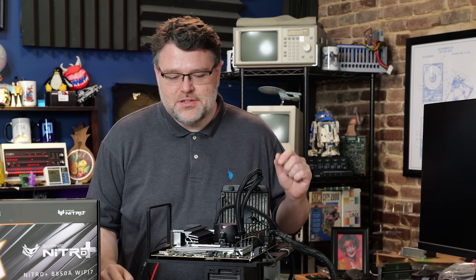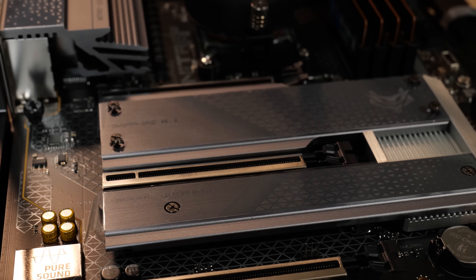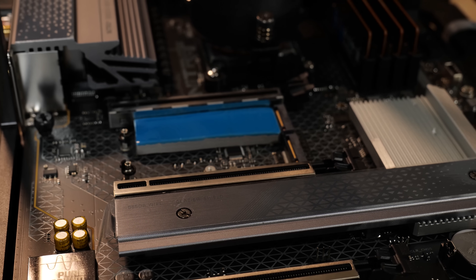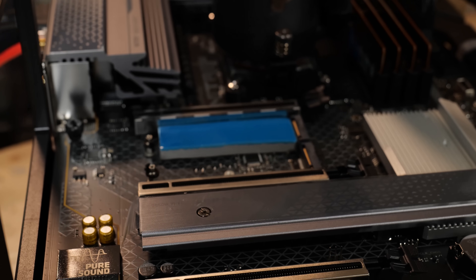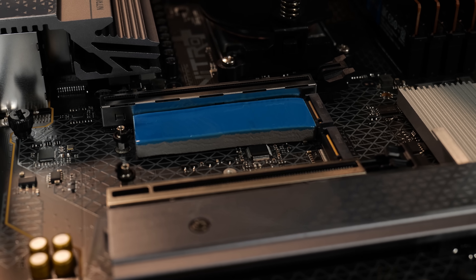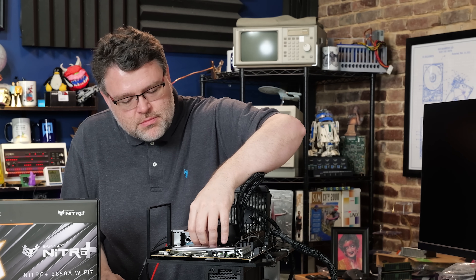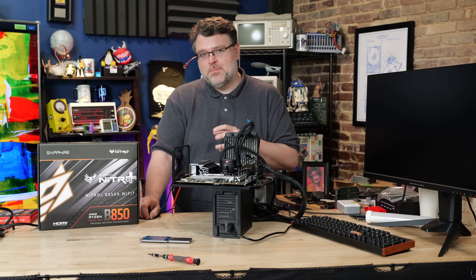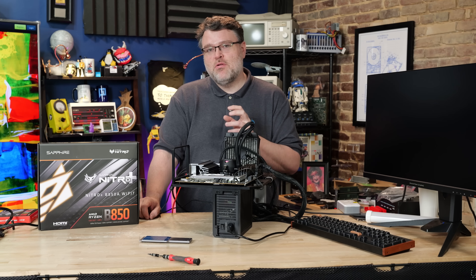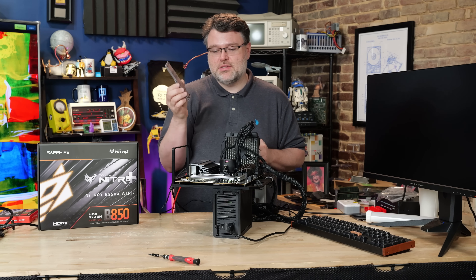Sapphire has made some unique design decisions. You've got four Phillips screws to access the tool-less quick-release M.2 holders. They also have the thickest thermal pad I've ever seen in my life — this is meant to carry heat from the underside of the M.2 to the motherboard. It's not super effective on its own, but it's very effective compared to no thermal pad at all if the heat sink is heat-soaking.